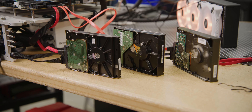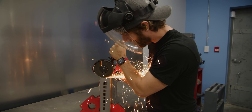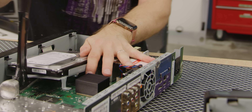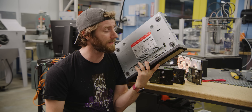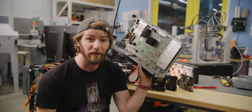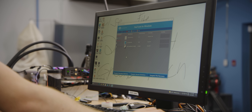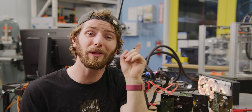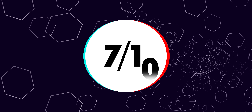All in all, we salvaged 1.16 terabytes of hard drives for about $23 US. Not the worst deal on earth, but Dylan failed to mention: the tools required to extract the drives; the precautions needed when working with equipment that has exposed power supply circuitry like these DVRs; the important step of checking the model number to find out how much storage it has before you buy; and the minor detail that these hard drives have been in use for a very long time under non-ideal conditions. Only two of them spun up and were detected, and only one — a 500 gig model — passed a short drive self-test. So overall, a lot more creative than shucking external drives, but these omissions cost Dylan 844 a few points. I give this tech TikTok a seven out of 10.